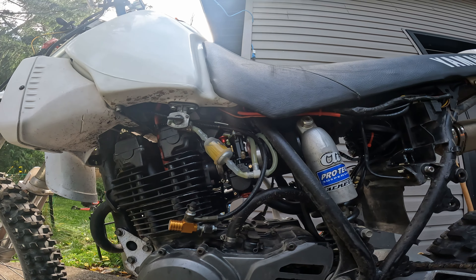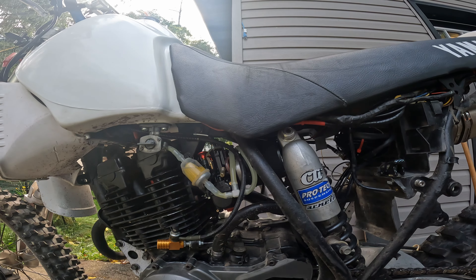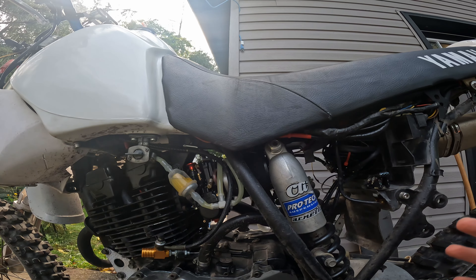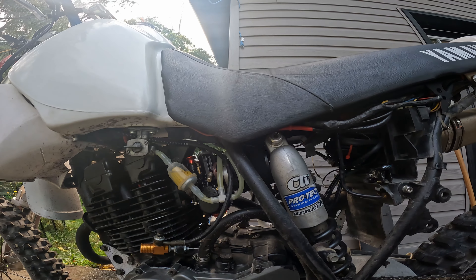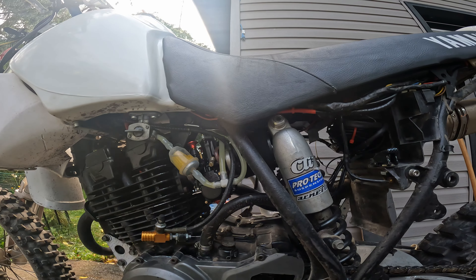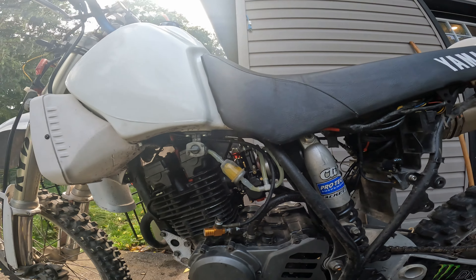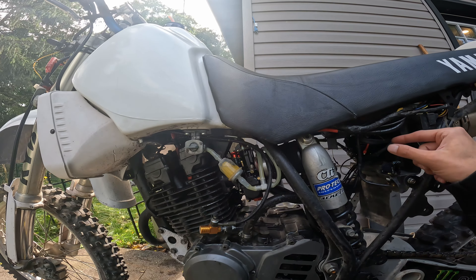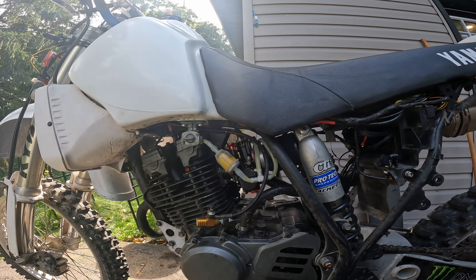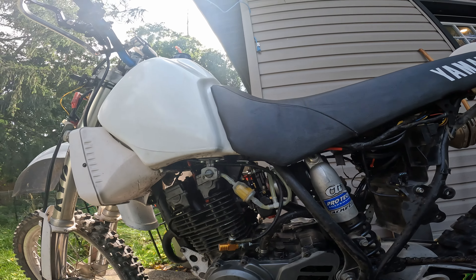The carbs work really well. On a warm day I don't even need the choke to start it. Air-fuel ratios are between 9.5 and 10 at idle; ideally 12-point-something, but you want it a little richer on an air-cooled engine because running richer gives evaporative cooling from unburnt gasoline, which helps keep it cool. Running air-cooled engines lean causes them to overheat quickly.